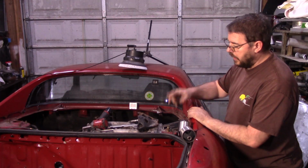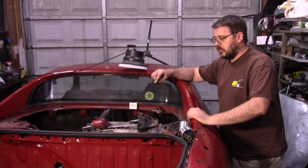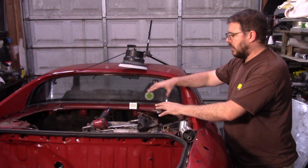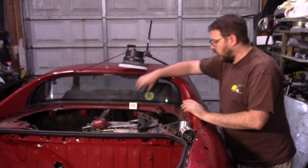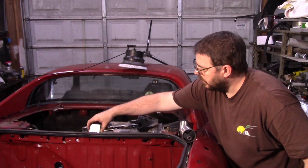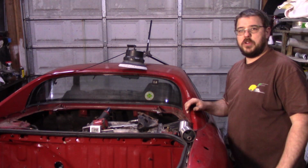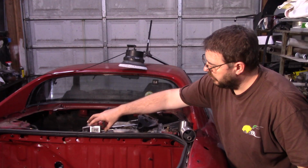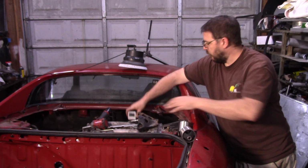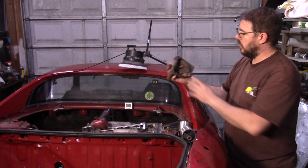At this point, we've got 3 known good locations, but the front mount has a little bit of a slot. So that allows adjustability for everything. And we want to put this so that the engine essentially sits near the middle, but more importantly, that the angle is correct. So when I jacked this up, I tried to put it kind of even, and you can see it's off by 0.4 degrees. And that's not a big deal. We can just zero this, and then we can place it here and see if our engine is level relative to our chassis. The way we're going to adjust that is I took this bolt pattern here.